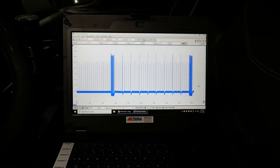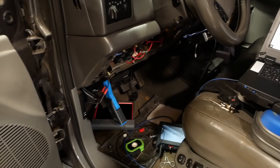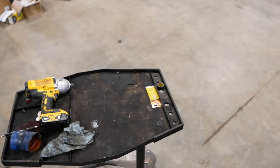It's kind of a redundant test because the FICM can tell on itself — it monitors current and knows if there's an open circuit on the primary side of the injectors. But when you're looking at throwing two thousand to twenty-five hundred dollars worth of injectors into this truck, it's nice to have some proof, some reassurance. That's a big chunk to eat if we don't fix the problem.